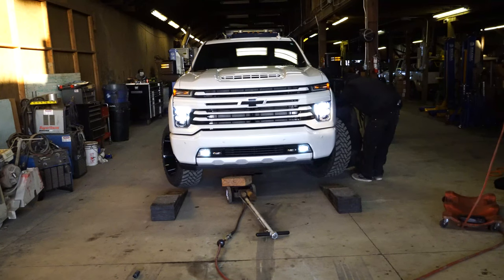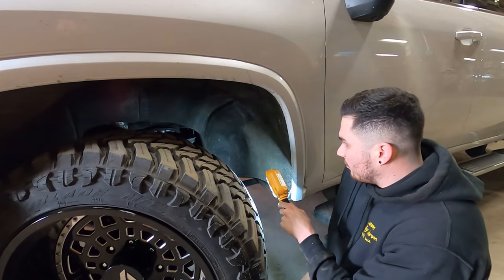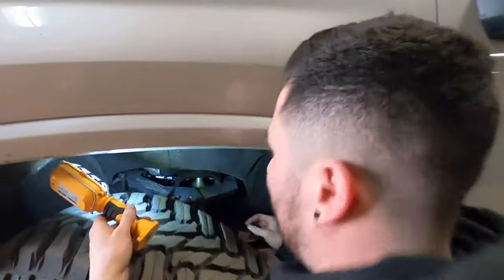That's how you adjust torsion bars. There's nothing left adjusting-wise: you need a 21 millimeter, jack the truck up, get the suspension off, and you can turn the keys like butter. If you have weight on it, it's super hard and really hard on the knuckles. A couple of things to check now that I've got this done — you check your upper control arms, because a lot of people have issues there.